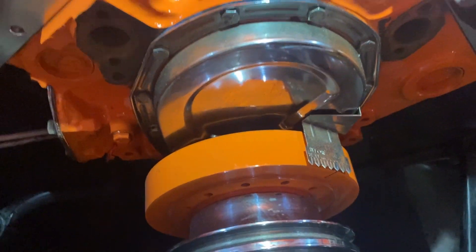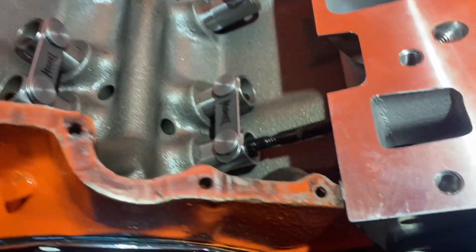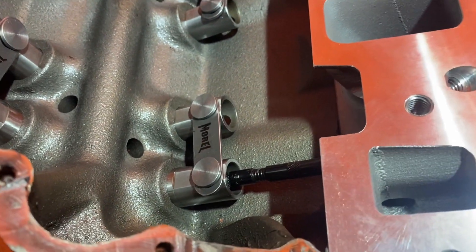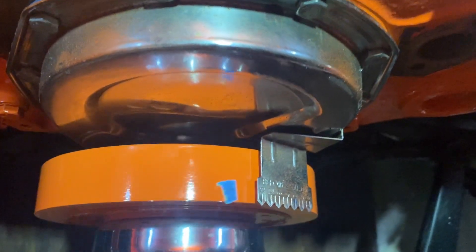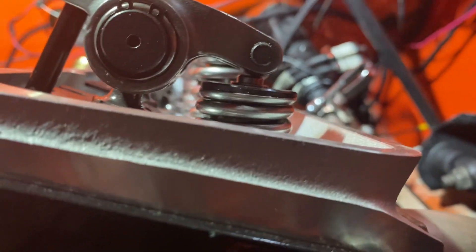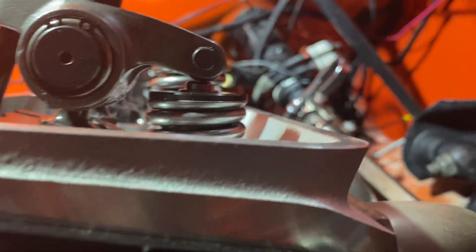So I'm going to crank this engine — working one-handed because I'm also working the camera — until this valve is fully open. Okay, it's starting to open. I've got it marked on the flywheel too, because I've done this before. Basically right there, now the valve is fully open. And you can see that the roller is now on the front or the exhaust one-third side of the valve stem.